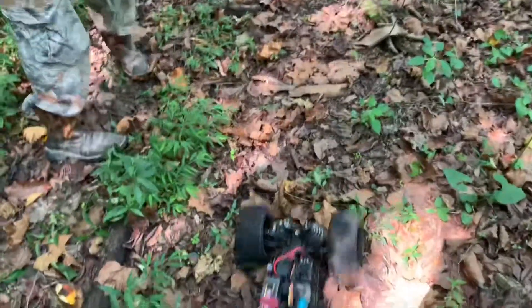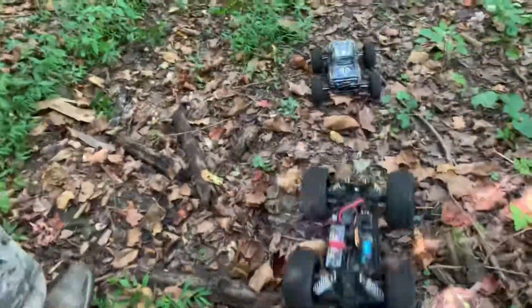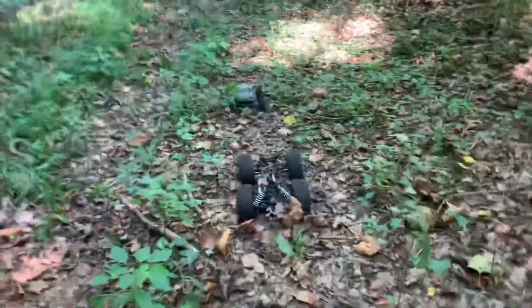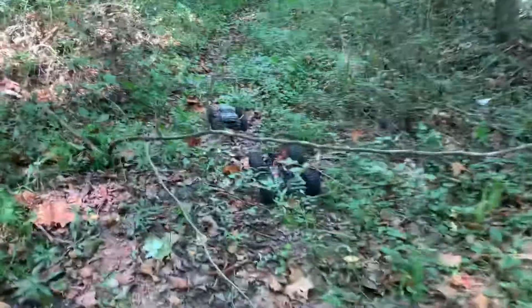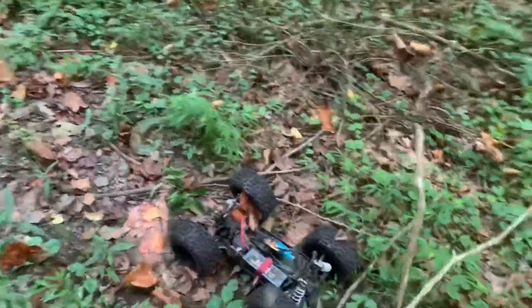I would give him a set of shocks but I can't find the top post — maybe next time, I just have to pay more attention. We're talking about the ones with the piggyback system. Those things are quite aggravating — you've got to purge the system after it's in, then open it up and refill because the overflow goes inside the piggyback system.